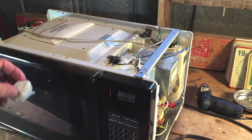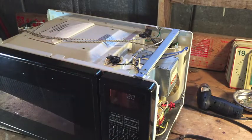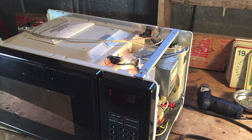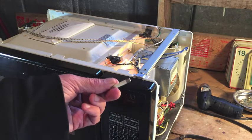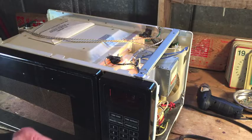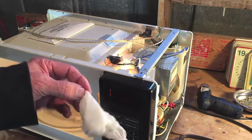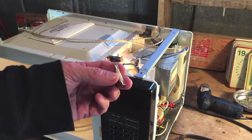Now I have a damp paper towel. Going to heat that up for about 20 seconds. When I hit start, if the fuse blows right away, I have another issue causing the fuse to blow — so hopefully it will run. From what I've read, fuses can fail due to age. I hope that was the case with this one because it is 29 years old — this is the original fuse for this microwave, since I've owned it since it was new back in 1993. No issues until yesterday when the fuse blew. So this should be hot — and it is. You can see the steam. Very hot.